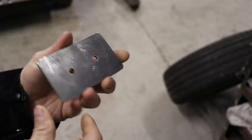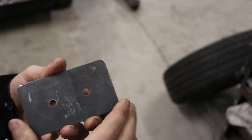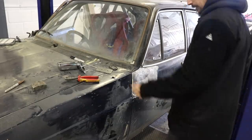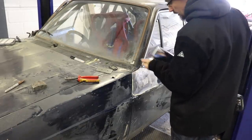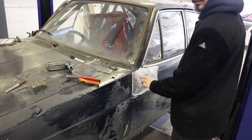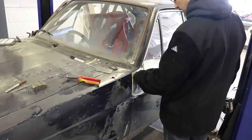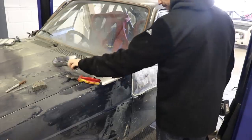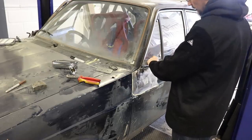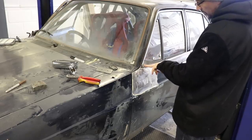So that's a little backing plate to sit on the inside of the door, just to support it on the back so the whole mirror isn't pulling on the one-mil door panel. These need to be quite a bit further back and a bit higher than the original one was, because if it's back here you can't see it. I think that's to do with this car having the folding-out windows, so this piece of rubber trim comes up much higher — normally the window goes all the way down here.